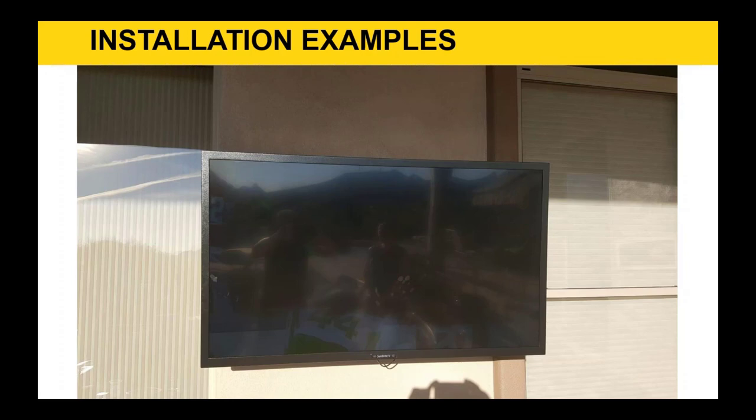As that sun shines on the front of the TV and the temperature begins to rise, we get what's known as an isotropic blackout — as the temperature goes up, the liquid crystals inside the display begin to get smaller and smaller until it shuts down altogether. Once they begin to shut down, black spotting shows up on the screen, and as neighboring liquid crystals shut down, that black spotting gets bigger and bigger. Now, this will happen with any TV — Sony, LG, any other brand — when liquid crystals get too hot.